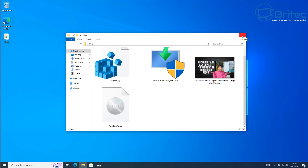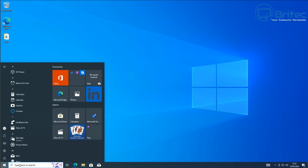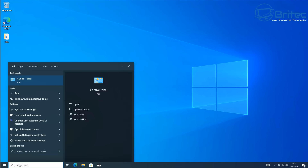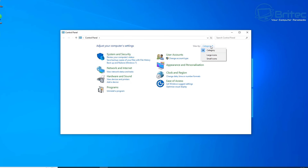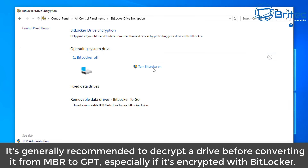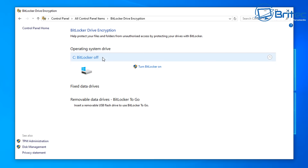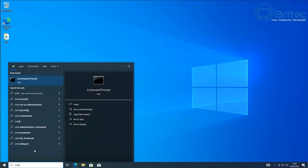I'm going to show you that it does actually work and you don't lose any data, but the risk is up to you. Another thing you want to do is check to make sure the drive is decrypted. If you encrypt your drive using BitLocker, it's always advisable to decrypt the drive before converting to GPT. It is possible to do it with BitLocker enabled, but I would always advise decrypting first to be 100% sure you can carry out the conversion without risk of losing data.